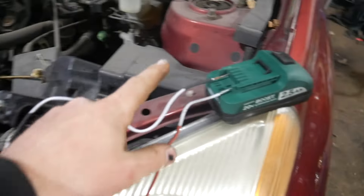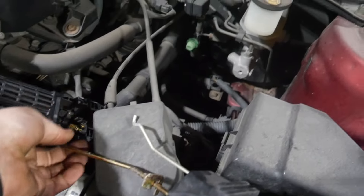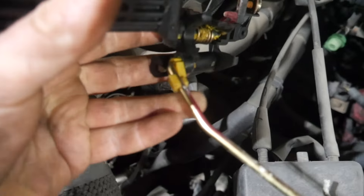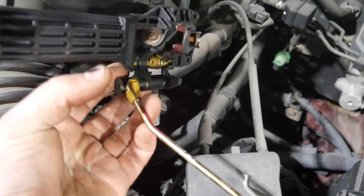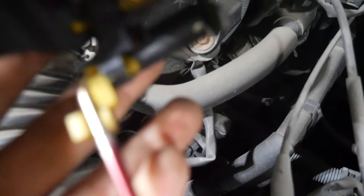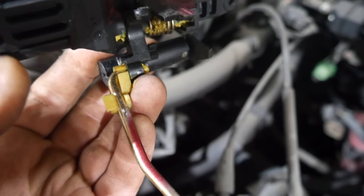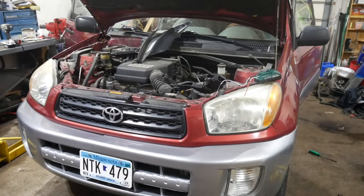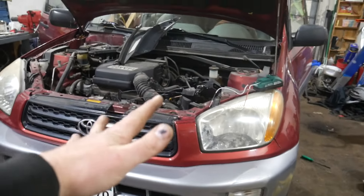You can see our little setup here. I was testing this door lock actuator. You see this little clip here? Normally you just pop these out and they pull out, but on the RAVs, it's actually barbed on the end here, so if you flip this up and think you're going to pull it out like any other car, that's not going to happen. So we got that addressed. I'm going to pull it forward a little bit, get it in the air. We're just going to check wheel bearings, brakes, fluid leaks, all that good stuff.